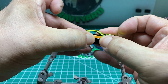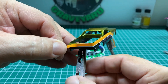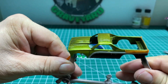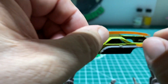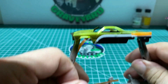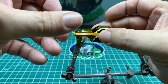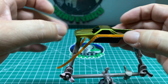Try and bend it as you go. You're going to have to push it down to make sure that no paint is going to leak underneath there, and just make sure that it's sealed along the other tape that you've got on. It takes a little bit of time to get used to the pinstriping tapes and how they work, so take your time with it. Experiment with it, and you're going to have a lot of fun with this — it's going to help you change your paint game. Sometimes you've got to press it down a lot to make sure that it's going to adhere, and just before you spray it is a really good time to do one last push to make sure it's touching the body without any gaps.